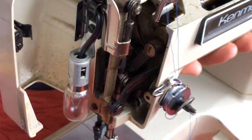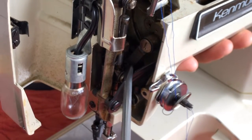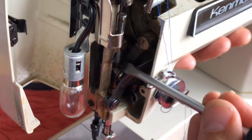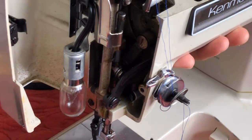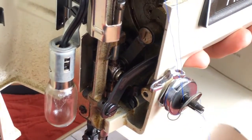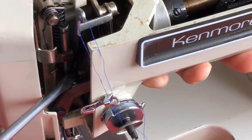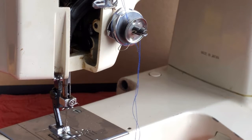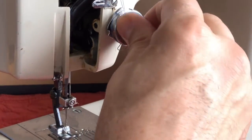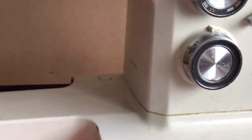I'm going to be focusing in this area right here — right next to, it's sort of an offshoot of the actual needle bar. There's a little bar here, and there's a mechanism that slides here, and that is what allows the zigzag to work. That's a place where you want to put both cleaner if it's full of old grease and oil, and then that's a particular area where you're going to want to apply sewing machine oil when you're re-lubricating the machine, because the zigzag uses that just as much as the straight stitch does for up-and-down motion.